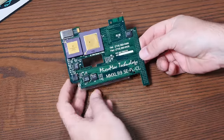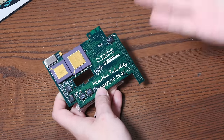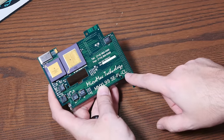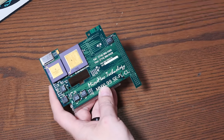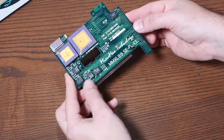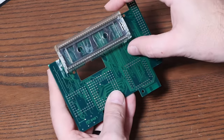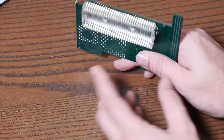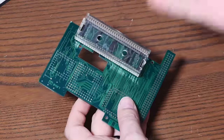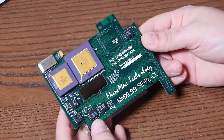Here is the Micromac Performer, and this came out of a working system, so I'm super excited to try this out. They made several versions of this card. You can see the 'PL' is crossed out here, meaning this is for the Plus. They also made it for the Macintosh Classic and the Mac SE, which were other 68000-based machines. I posted this on the Tinker Different forums, and it turns out this is a pretty interesting version because there is no PDS connector to put this in a Mac SE. And there is a Kili clip on it — a lot of these didn't have the Kili clip and would replace a socketed processor. But this is meant to clip over top of a soldered-on 68000 processor and piggyback the 68030 board on top of it. That's super cool.